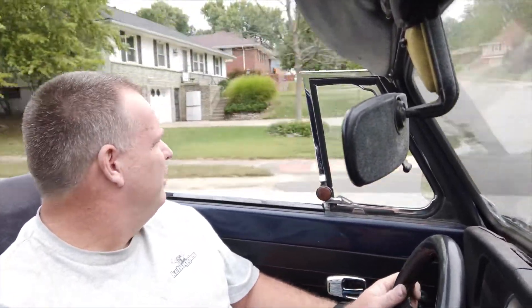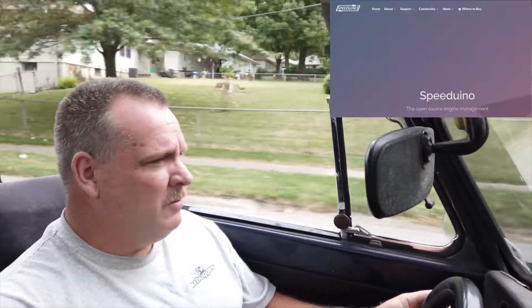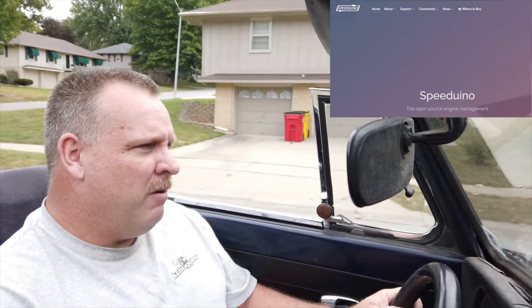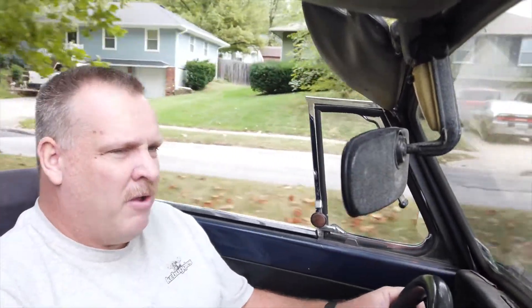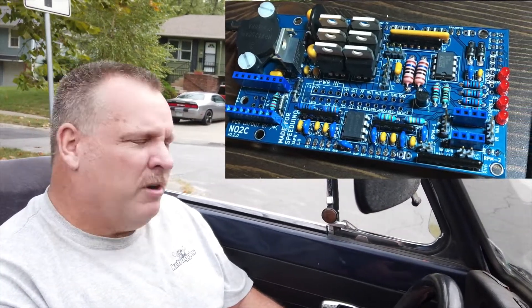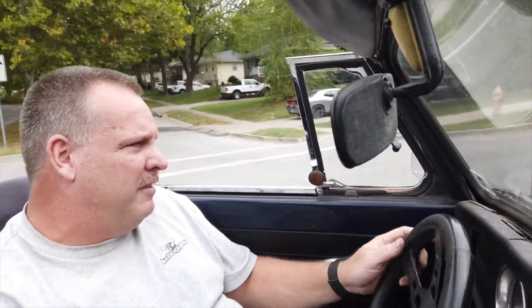I've always wanted to run fuel injection, and I just started getting online and I found a cool open source project called Speeduino. It's a fuel injection system run off of an Arduino Mega 2560, and these are the little daughter cards — there are several different versions out there. I'm running the NO2C, so no overhang, two channel, which just means that the daughter board is the same size as the Mega. I ordered that and soldered it all up. I do have a build video for that — I'll link below.